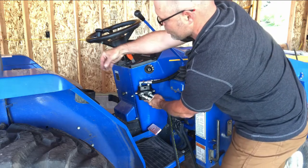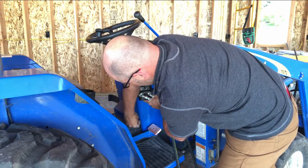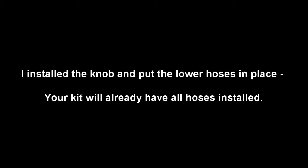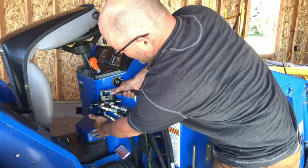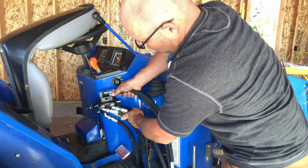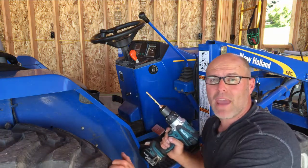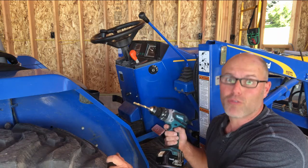I've already loosened the screws here to take this dash panel off. I don't have to take it all the way off — I just need to be able to reach behind there to mount the switching valve. I'm going to hold it right up here and make sure I've got a spot that is unobstructed to move that valve in and out, then mark my holes for drilling and get my drill with a 5/16th drill bit ready. Before you start drilling, reach behind that panel and make sure there's nothing critical you're going to hit, and make sure you know how deep you can go before you hit something critical.